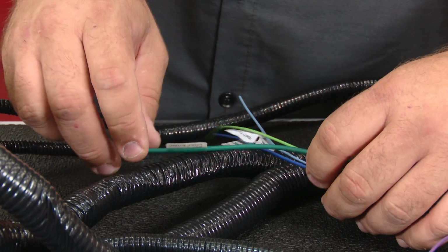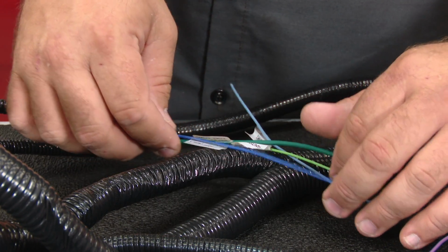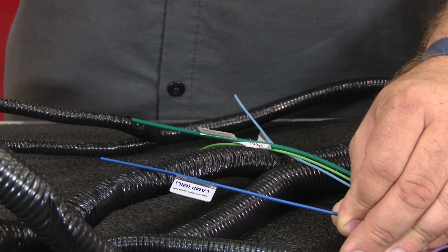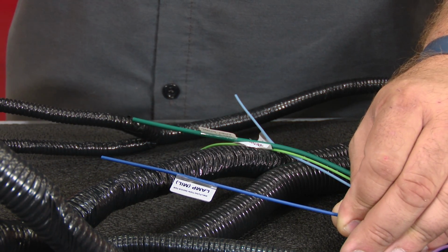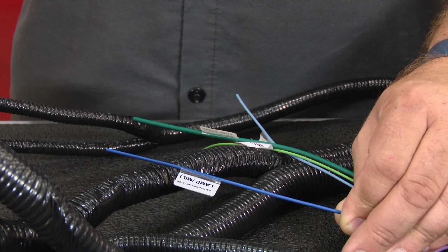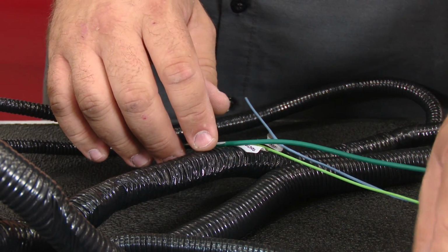And these four, we'll actually leave these for the end. This is your MIL light. This is going to go out to the included check engine light on your dash, just like a modern car with a check engine light. This includes a lamp. This goes to that, runs 12 volts to that light in case there is an issue with the computer.